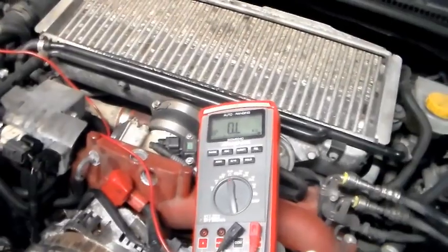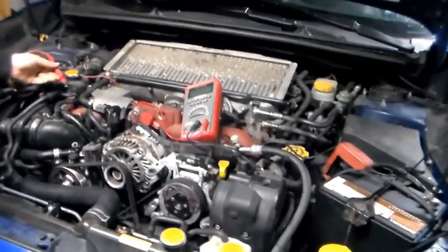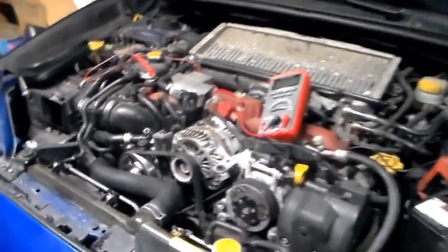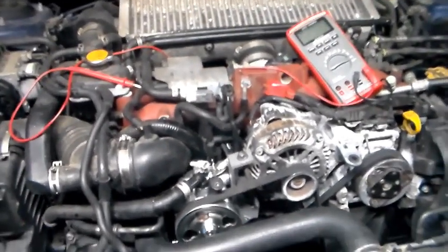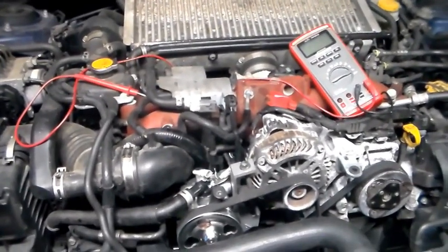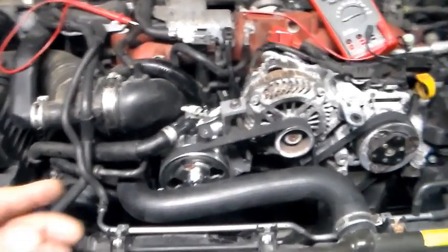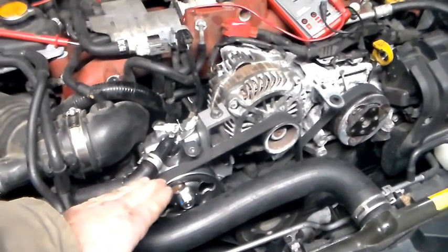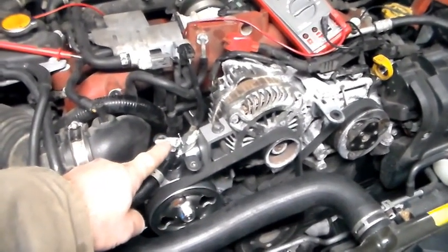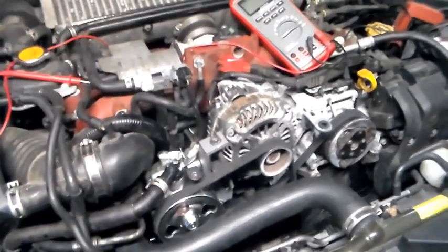Okay, go ahead and shut it off. Any reading other than 0.2 — right around there — is too high and will tell you you have a bad power steering pressure switch. That will kick the ABS light, could kick the traction control light — you'll get several lights coming on at the same time. This was a pretty easy diagnosis for us because we literally touched nothing other than simply replacing this pump and unplugging that one wire. Before that, the car had no codes, so I knew it had to be something here.